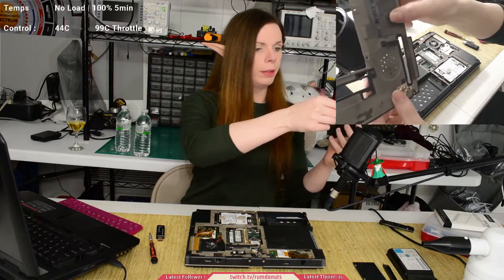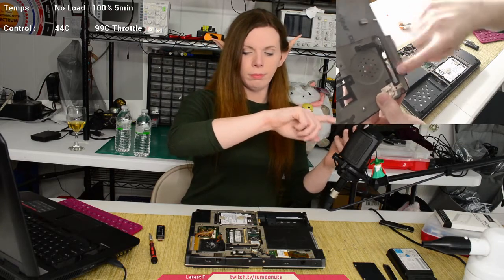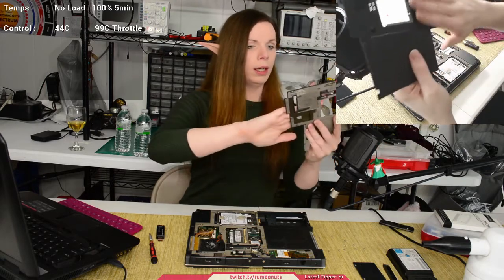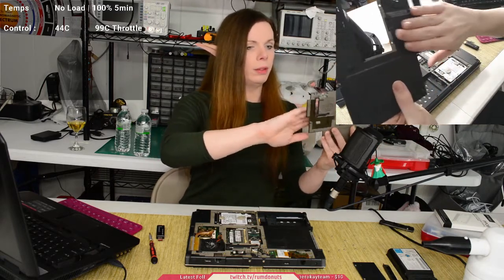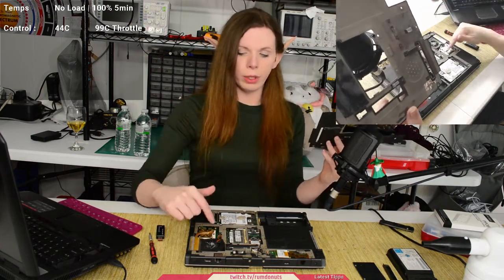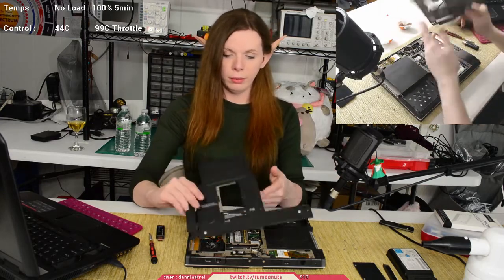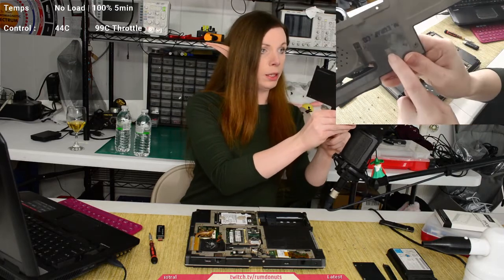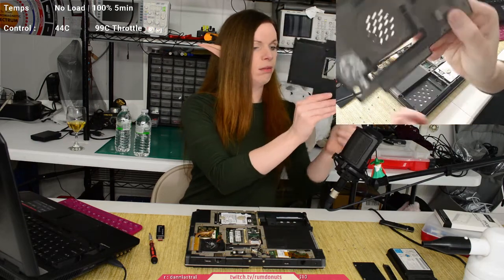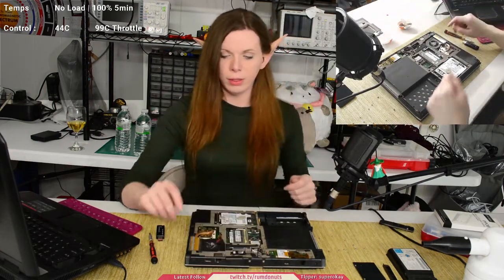And it's got a little pad right here, which is really sad. I think I can do a little bit better than that. The main heatsink rests right here and diffuses out into the case and out to the bottom, which is right here, and right here does get really, really hot. So it looks like there's a lot of room to shim, especially in here, because all it really has is this one little tiny crappy transfer foam pad. That's not very much. That's probably one of the major reasons it's overheating. There's not a lot of cooling going in here.